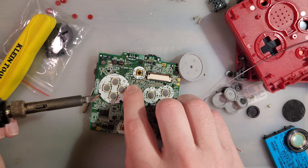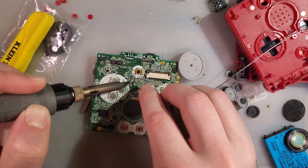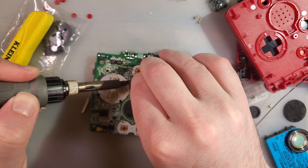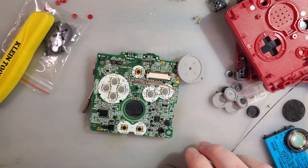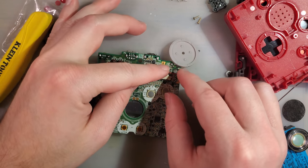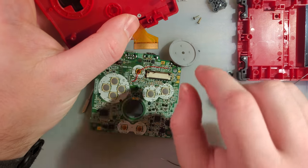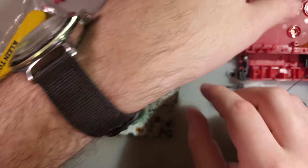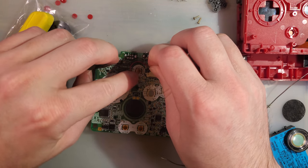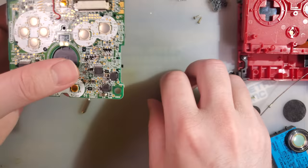And it gets soldered to the little test point marked Q12B. And yeah, I'm so used to having to bring this around and then wrap it over. This actually goes on this side, so it can be much shorter than that. I think I'm gonna leave it long and just wrap it around anyway though, just to give some slack. I feel like that's the safest option.